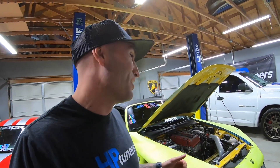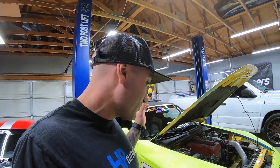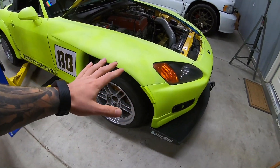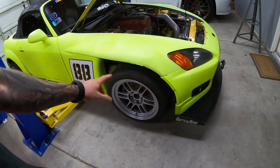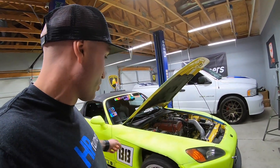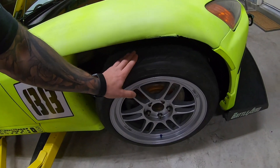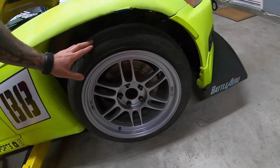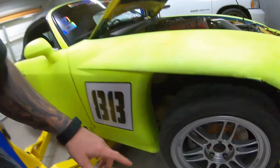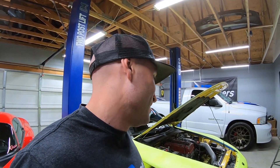It handles just about as good as a go-kart. I haven't touched it for a little while, but I want to get it ready for tomorrow — we're going to be changing the oil and doing some checks. For those who don't know, we have Raybestos racing pads on this, newer rotors, a race compound pad on all four corners, steel-braided brake lines, and super-grippy Federal tires. These are a 200 treadwear, meaning they're a really soft compound tire.